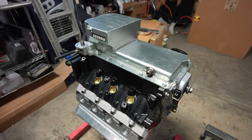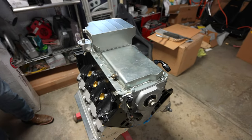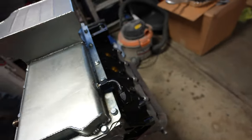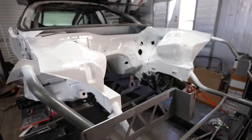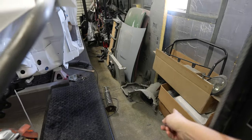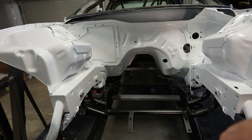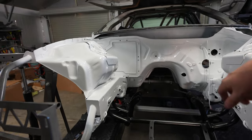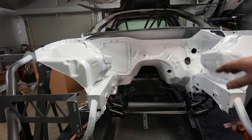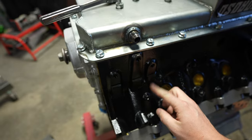All we need to do now is get the motor mounts bolted to this thing. I already got all the front and rear covers torqued up. We've been trying to decide if we're gonna take the Turbo 400 mock-up case, hook it onto it, and then put it in. I probably need to remove the little cross member in there, hook it to the tranny, and then it'll come up in there. Hopefully I don't ding up my new painted firewall or the transmission tunnel too bad. Right when you think all you gotta do is throw motor mounts on it and stick it in the car...